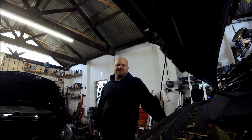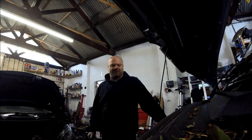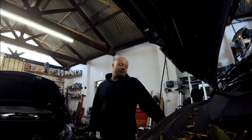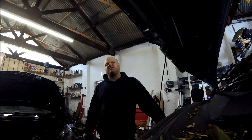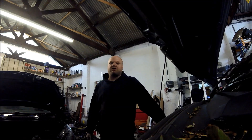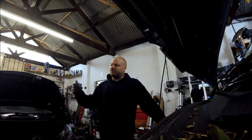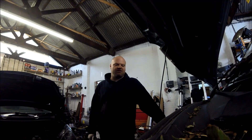Hello and welcome to my channel. Today I am changing an alternator on this Ford Transit 2.2, model 2006. I'm going to make a video showing you how easy it is to change your alternator. The only technical thing about this really is when you put the belts back on — rather than having tensioners on this motor, it's got what's called a stretchy belt system, so you have to stretch the belts back over the pulley.